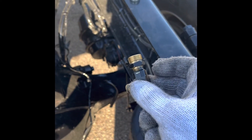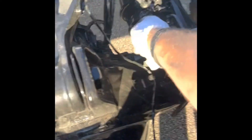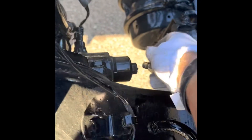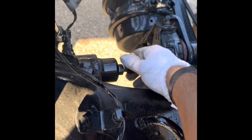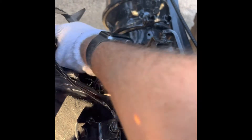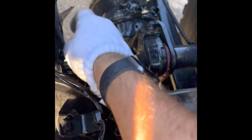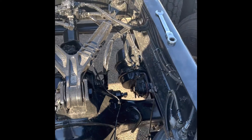These fittings are usually with the keys on Kenworths, and on Freightliners they usually stick them back in the hose that attaches to it. You just go ahead and screw the fitting back in there and tighten it up, put the hose on and tighten all that up. On Freightliners you still have to clip the electrical thingy in there too.